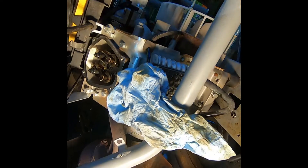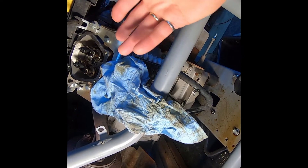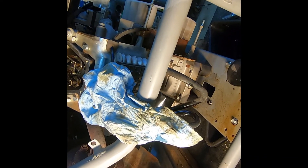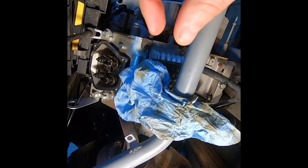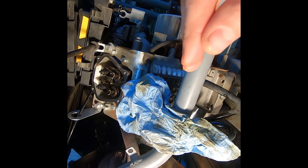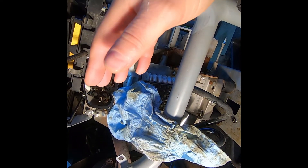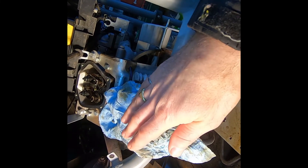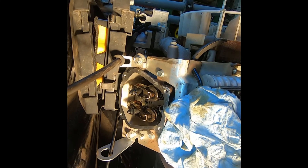I recommend that after you think you're all done, rotate the engine around fully and then recheck all the valves to make sure they are precisely where you think they are. Pay attention to top dead center on the compression stroke — that's when you want to do the valve adjustment. If you're in tolerance but on the tight side, adjust it to the middle. If you're on the loose side, leave it alone — you're not going to damage a valve that's loose. But if it's on the tight side, especially an exhaust valve, the valve won't seat properly and won't exchange heat into the head, and you can burn the valve or valve seat. It's better to be a little loose than a little too tight. Good luck with the DIY videos — if you like my video, please subscribe.